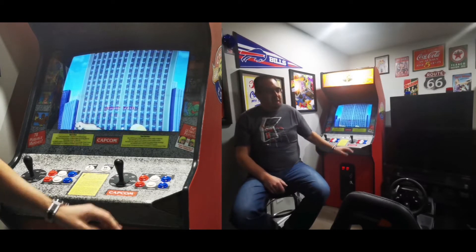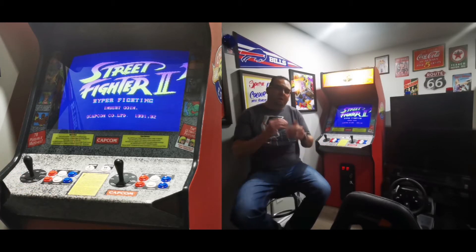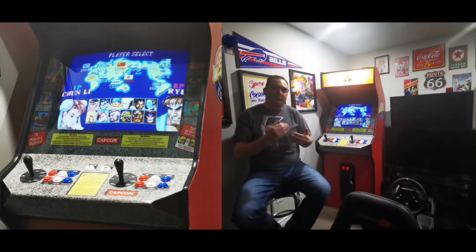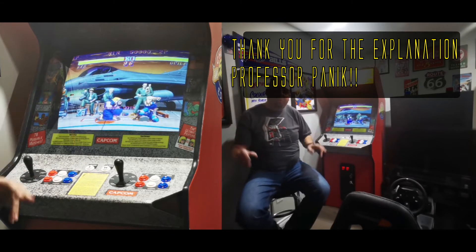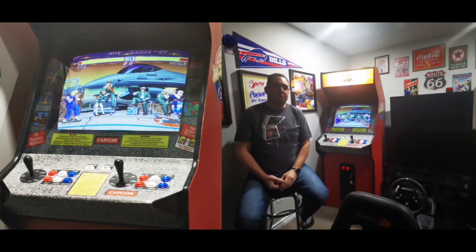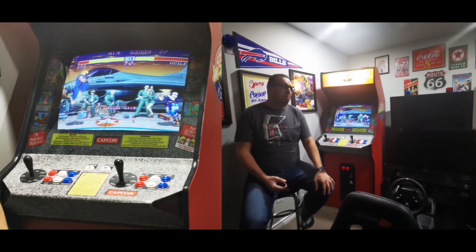Fast forward — with the MAME setup I was running Ultimarc's ArcadeVGA, an ArcadeVGA 3000, which is now obsolete. What the ArcadeVGA card does is it's an ATI card flashed with special drivers that allows MAME to run arcade games on a CRT monitor at their true native arcade resolutions. I was very new to the computer world back then but somehow I finagled the setup and got it to work, so I left it alone.